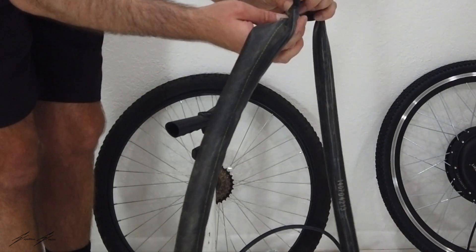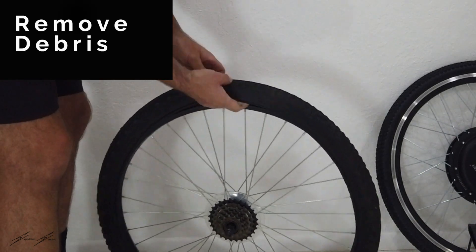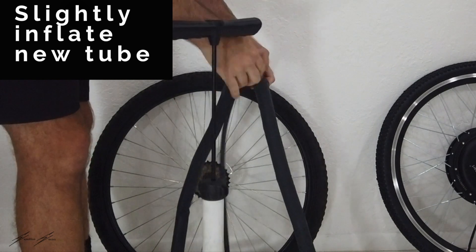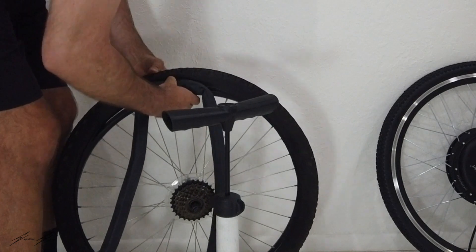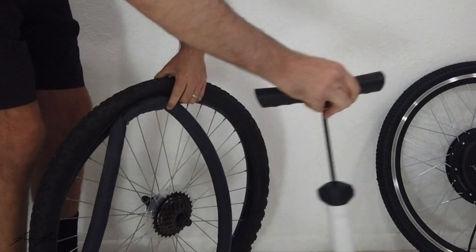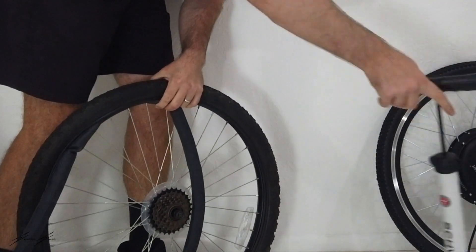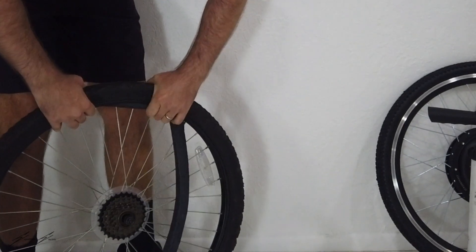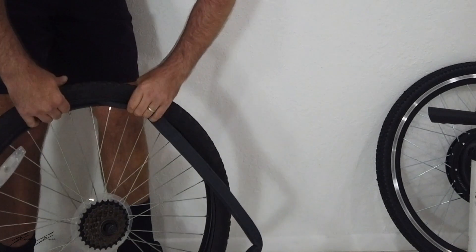I've already figured out there's a big hole right next to the valve. I'm going to check the rubber of the tire to make sure there's no debris — I think that tube was just very old. Here's the new tube. I'm adding just a little bit of air so it takes shape, not too much, then inserting it at the valve and slowly working the tube in. I'm using a standard floor pump — a Schwinn brand. I definitely recommend getting a floor pump like this if you have a lot of flat tires, since it goes much quicker than a travel hand pump. I'll put links for the tire tubes and pump in the description below.